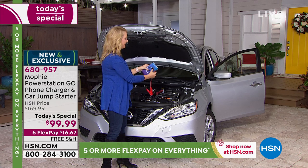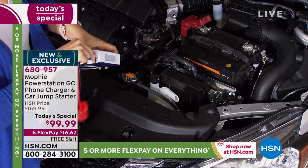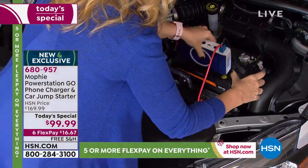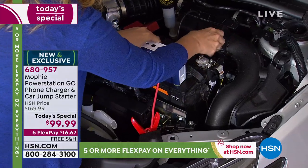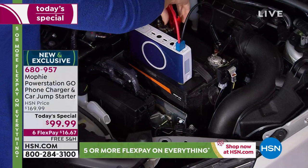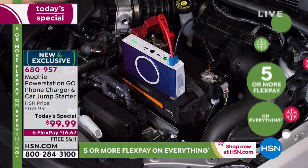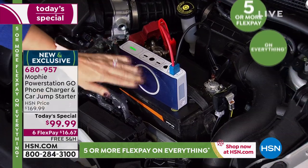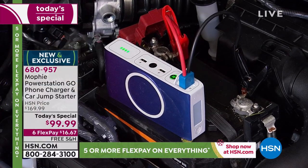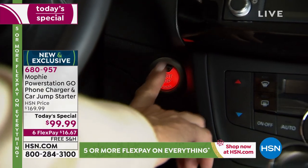Really easy, guys. You're getting these jumper cables, and they only go in one way. So all you do is just pop them right in, just like this, okay? Then you're going to attach, and it goes anywhere on this battery. So I'm going to do black to black right here. Red right here. And in a couple seconds, all I'm going to do is press this button right here. Green blinking means thinking. So this is processing through the safety checks. Now, guess what? Solid green light. That means go. Suzanne, go ahead and power the vehicle. Ready? Yeah, and all my stuff's lit up in here saying go ahead.